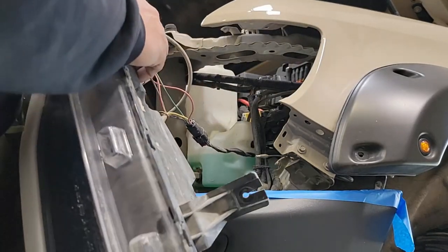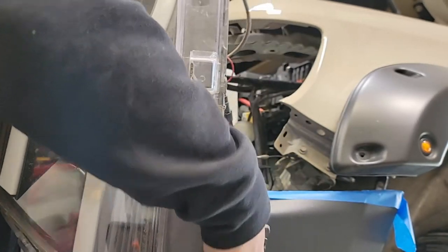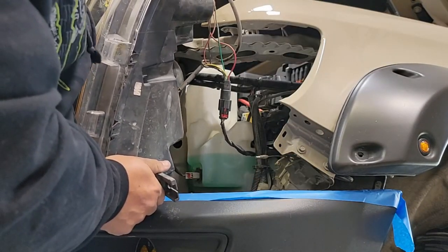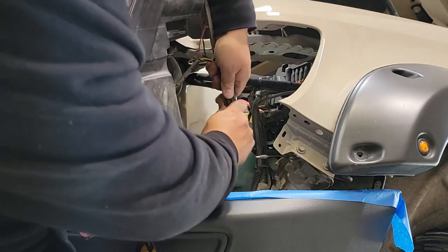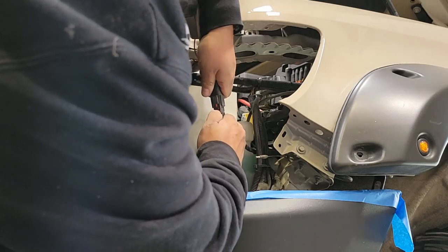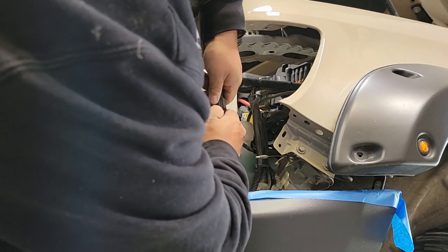The wire harness here is a little different — this is an aftermarket headlight assembly, not a factory one, so it actually has a wire harness. The factory unit will be plugged in at the back of the plastic housing versus one that's a wire. It's a little tighter and harder to deal with, but the principle is the same: pull the little safety retainer and unclip.